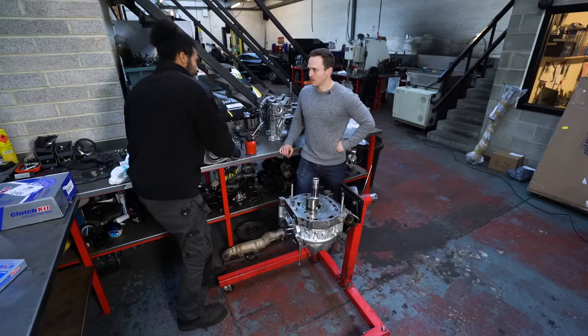This is the front pulley bolt for the engine — I put a new o-ring on the end of it. Before you screw this into the e-shaft, you apply a little bead of sealant all the way around the outer edge, just to prevent oil from coming out. When just putting the bolt in to measure end play, 300 Nm, but otherwise 290. That's pretty much that. Then you've just got to put the sump on — just scraping the excess sealant off to make for a flat surface for the sump to bond onto. This is the new oil pickup with a new gasket, straight on there, two 10 mils. Here's your freshly cleaned sump.